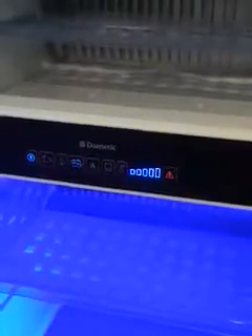The 12 volt option is off your vehicle electrics, not off your leisure battery. It's coming from when your engine's running and you're travelling — it will actually keep the fridge cool, but it won't cool it down. It just maintains the temperature that it's at. So you have to put it to that when you're travelling. You need to cool the fridge down before you travel, then switch it to 12 volt and it will maintain it as long as you're not opening and shutting the door too often.